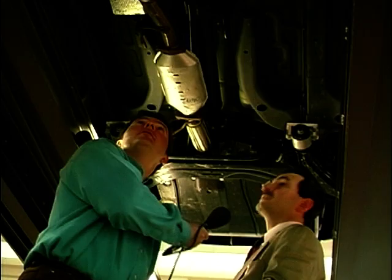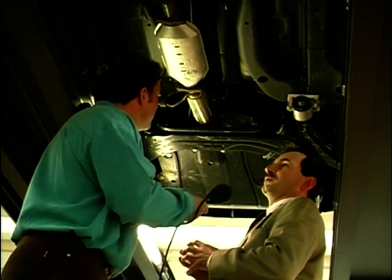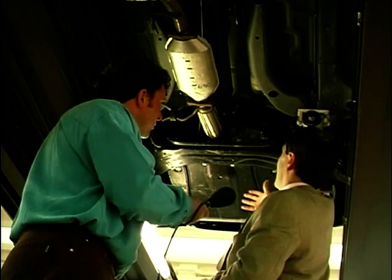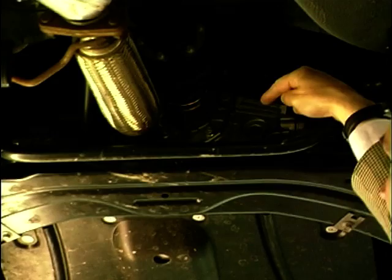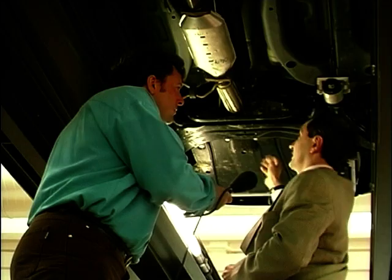There's very little here — it's a different application in terms of technology for a very different sort of customer. We're looking for very simple four-wheel drive controls, and that's what this vehicle offers. First of all, the engine is placed like a front-wheel drive car — it's across the vehicle, what we call east-west — and the gearbox is mounted on the side. Off the back of that is the equivalent of the transfer case, which we call the intermediate reduction drive. That does the same job of splitting the drive — to the front wheels directly like a front-wheel drive car, and also down the prop shaft here to the rear.